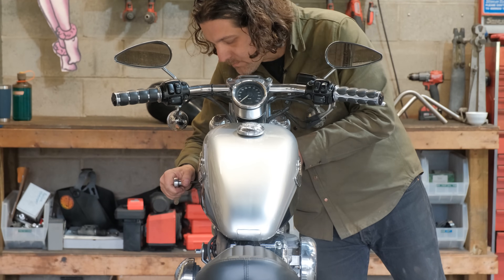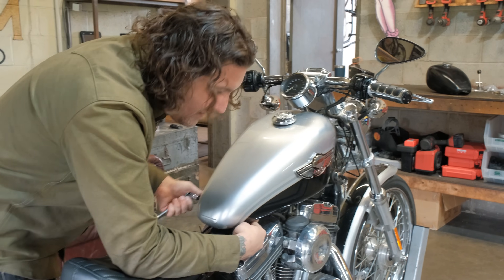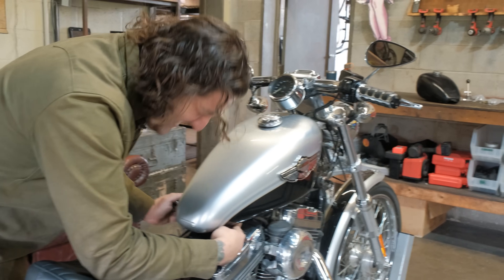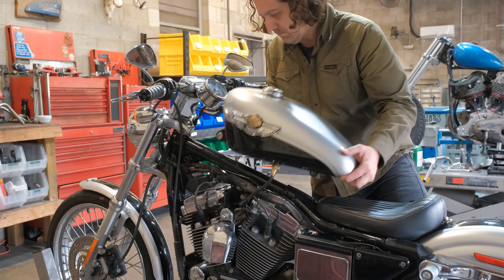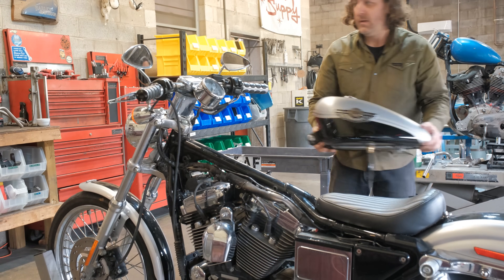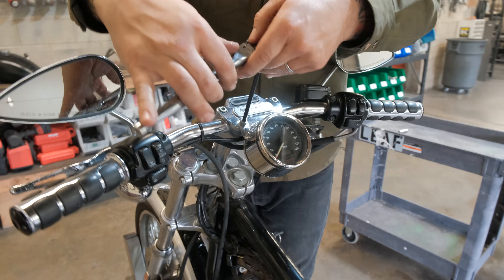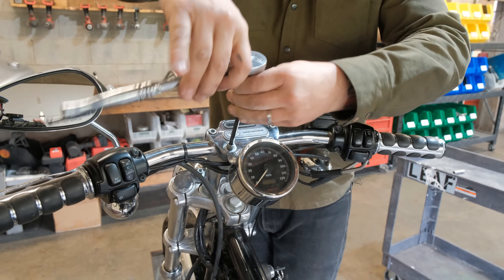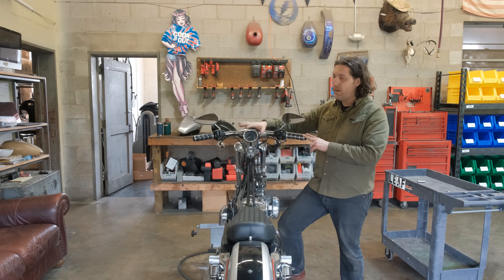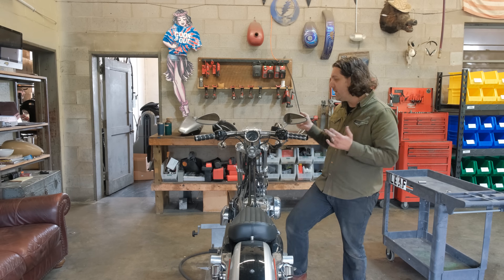The first thing I'm going to do is pull the tank to give me some room to work — get rid of some of the handlebar controls, wiring, and everything like that. We'll take the tank off, take the vacuum lines off the tank, take the ground lines off the tank, and just go from there. Now that I've got the tank off, I'm going to slowly work on getting all the handlebar components off so we can put new risers and new bars on. There's a lot of wiring going on inside here, so it might take a minute — kind of depends on your bike.